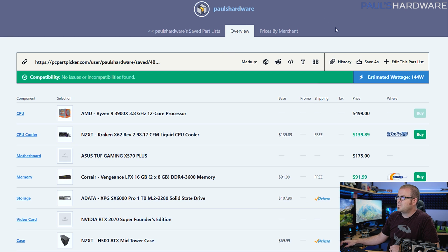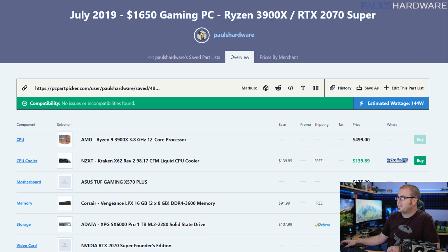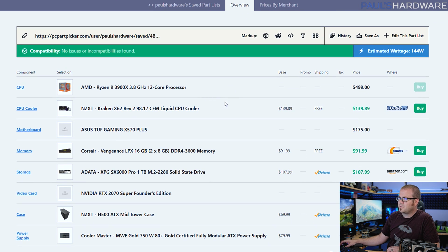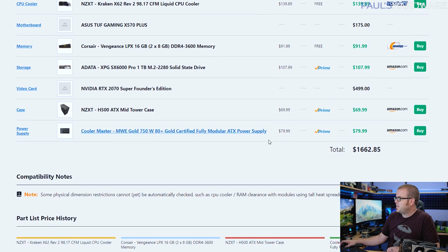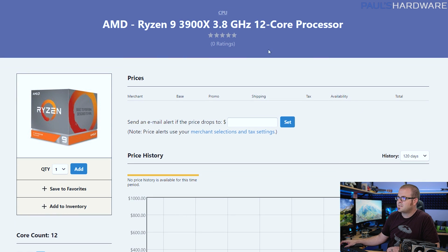But let's move on to our second build for this month, which is the $1,650 gaming PC, a bit more all-out, a bit more high-end. This one's using the Ryzen 3900X, and I paired it up with an RTX 2070 Super, since we now have better prices on better performing RTX 2070 cards with the launch of the Super. But looking at the total price here, I'm actually a little bit over my $1,650 budget. $1,662.85 is what it's coming out to, but let's run down the parts.